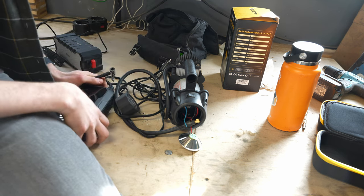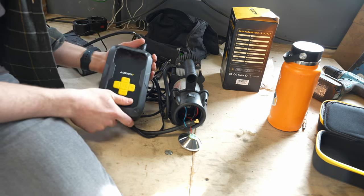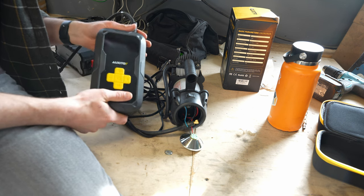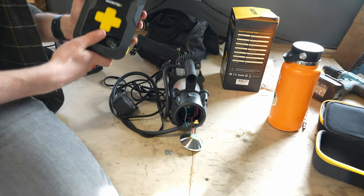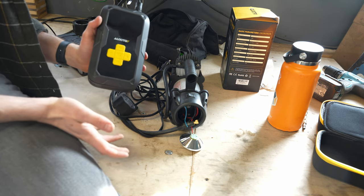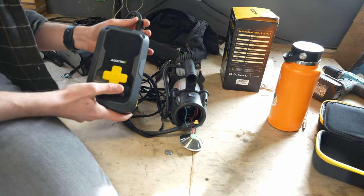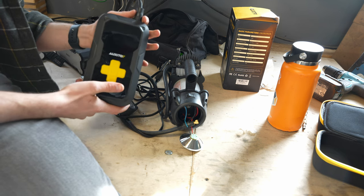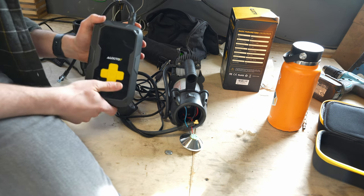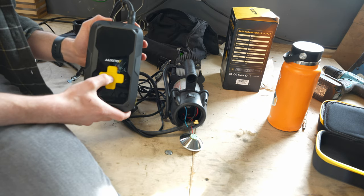I am very curious how this performs. What we're going to do is drop the tires down to about 20 PSI and fill them back up to 40. I want to see how long it takes, whether it overheats, and if it's worth it in a pinch. I see this more as something not to use every single time when airing down and airing up — I think you'll get too much wear. But when you notice your tire pressure is really low or seasons are changing, you can do it in a pinch. Going from 20 to 40 — let's see how long that takes.